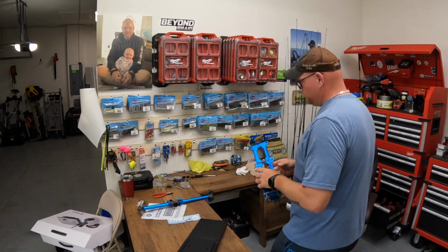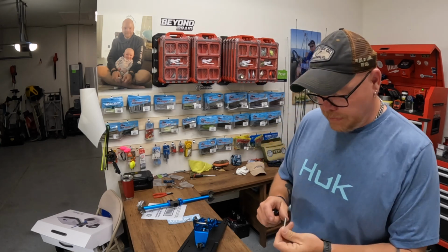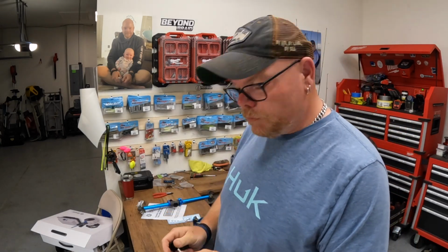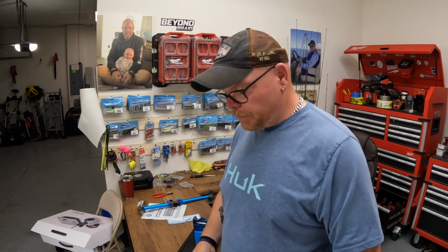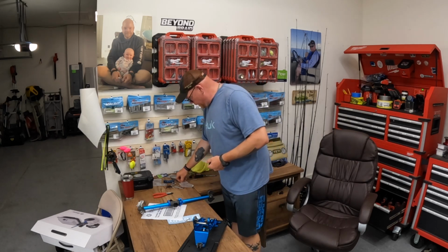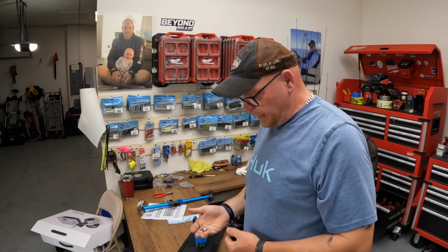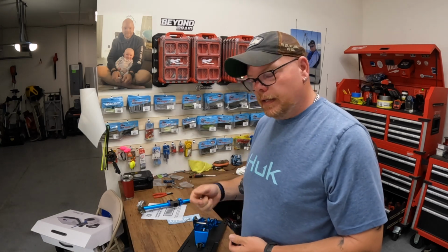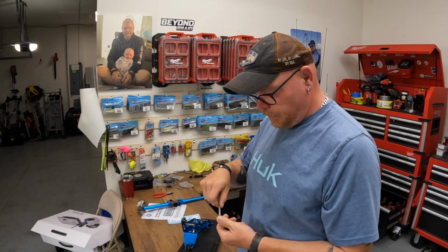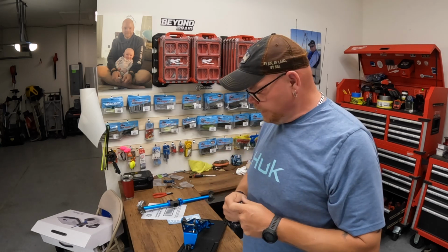So Bixpy gives you the options. Bixpy gives you the stainless steel 1/4-20 hardware, and it gives you the nice option of thumb screws. So when you mount this on there, you can easily take it off with some thumb screws, or they give you the nylon nuts. Now, that's if you want to leave your mount on there all the time, but what I'm going to do, I'm actually going to run Bixpy's hardware through the One Objective plate, and I'm going to use the nylon nuts, not to hold the Bixpy adapter plate on, but to hold the hardware underneath the One Objective plate, and use the thumb screws, so I can take this motor on and off.